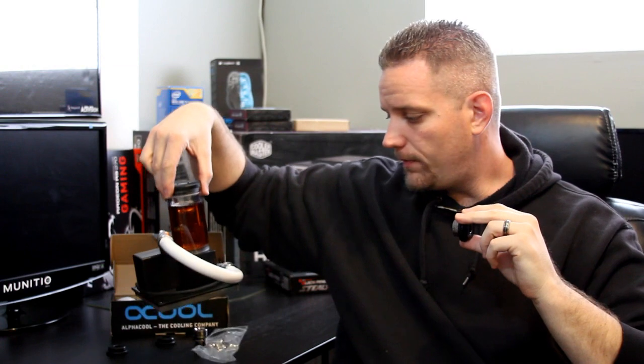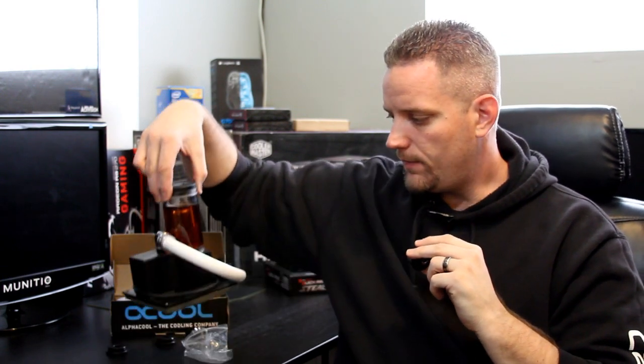The reason why this is assembled before the review is I wanted to see if a leak would form with this running. I left it running for over a day — no leaks formed. It's been sitting here now for at least a week put together like this, no leaks. So I trust the O-ring fittings on this; they're really, really tight. You just push the two pieces together and you've got your pump and res connected.